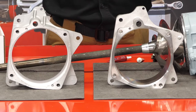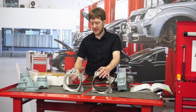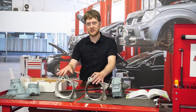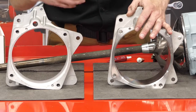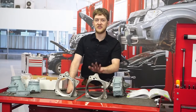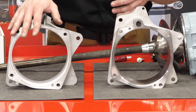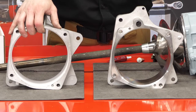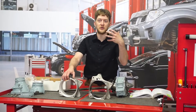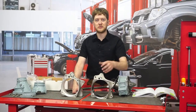So what are the advantages or disadvantages from one design to another? In a high performance application, plastic wear rings can run a tighter tolerance to the jet pump, which is advantageous in some cases, but they're still vulnerable to damage from debris. The stainless units are significantly more expensive but in most cases offer better overall service life. If you're looking for bang for the buck, go for the nylon — much more cost effective and not that labor intensive to replace, especially if you're handy. If you're not a do-it-yourselfer, the stainless wear ring may be the better option because you'll get more service life out of your investment.